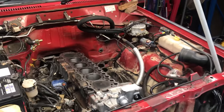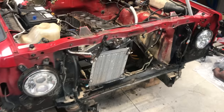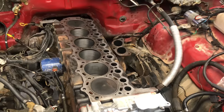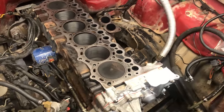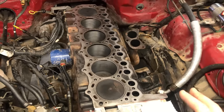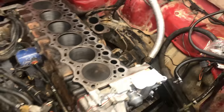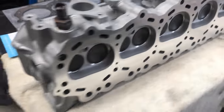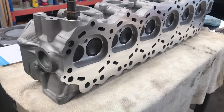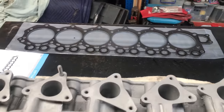We're ready to put the head on this morning. I've dropped the car back down low, it's back on blocks of wood to get everything easy to lift the head over. I've gone over and cleaned all that up again. We're back to where we were two weeks ago. Timing cover's on, everything's timed up, head's ready to go on. I've gone over that with some thinners, made sure it's all clean again. Blowing the cylinders out to make sure there's nothing in any of them. The head is looking just fantastic now it's been rebuilt.